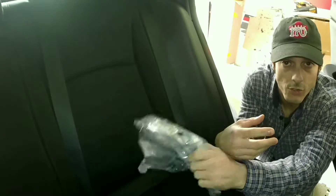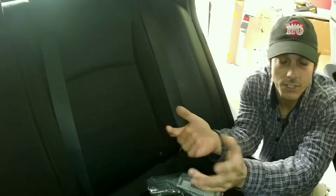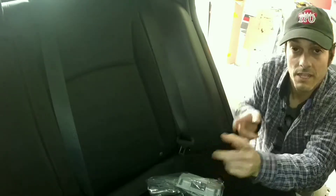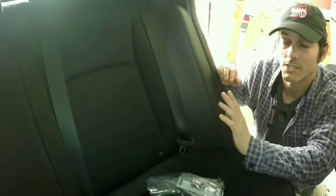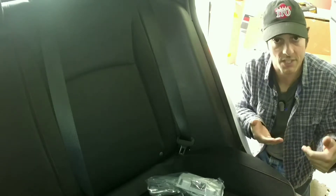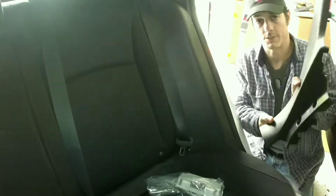There's just one last thing to do to complete the suspension install, and that's to replace the suspension controller that's mounted right under this panel. I specifically bought this car as a four-door, and this is one of those times I'm really glad that I did — because according to Honda, the two-door model has the suspension controller mounted in basically the same location, but as a coupe you'd have a passenger side armrest which would have to come off, plus the back seat needs to be removed and so on. With the four-door, it's literally these two panels and the suspension controller is right here. I need to remove the bottom panel first, and it just pops out with a couple of clips — just like so.